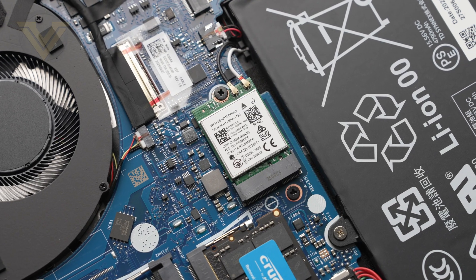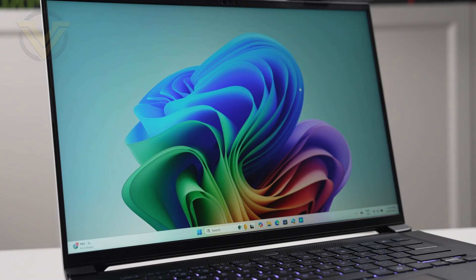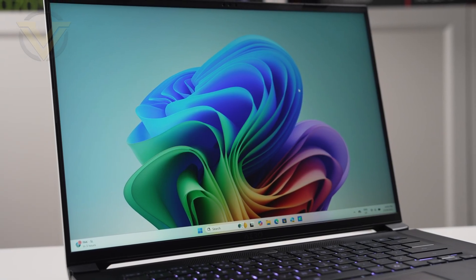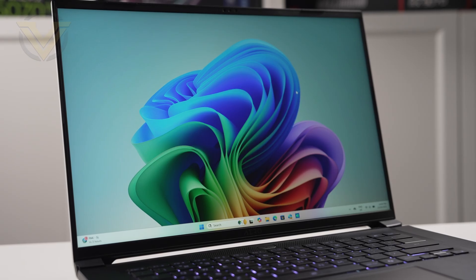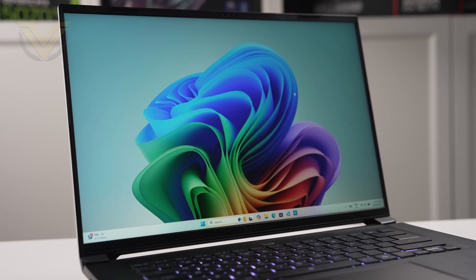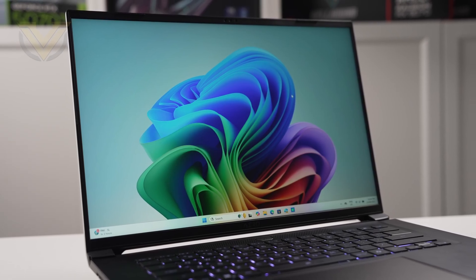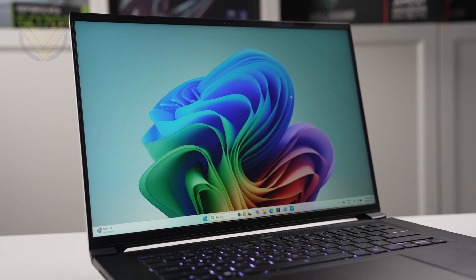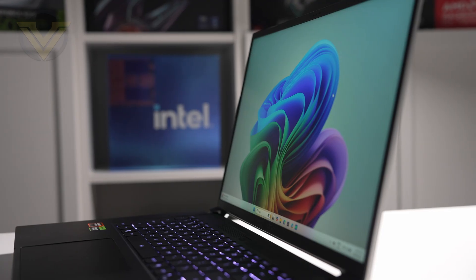For networking we have 1 gig ethernet as well as Wi-Fi 6E from a Realtek 8852CE module, giving us tri-band support and Bluetooth 5.3. The screen is IPS and 16 inch. With the display there are two options for the Aero X16: a native resolution of 2560x1600 or 1920x1200. Our laptop has 2560, so the aspect ratio is 16:10 rather than 16:9 — hence we don't get 1440p. The refresh rate is 165Hz which is nice, but I feel a laptop of this caliber should be aiming higher. Having the 8 gig RTX 5070 means gaming beyond 1920 resolution could be a bit of a challenge, which we will investigate.